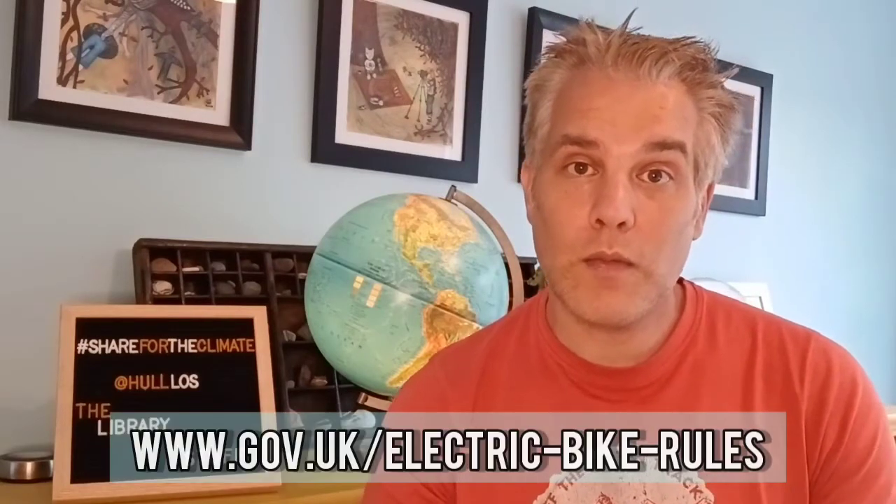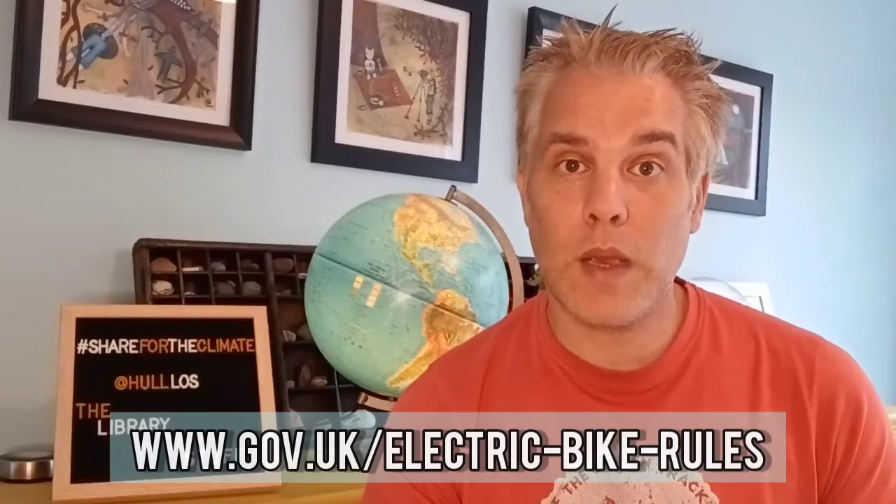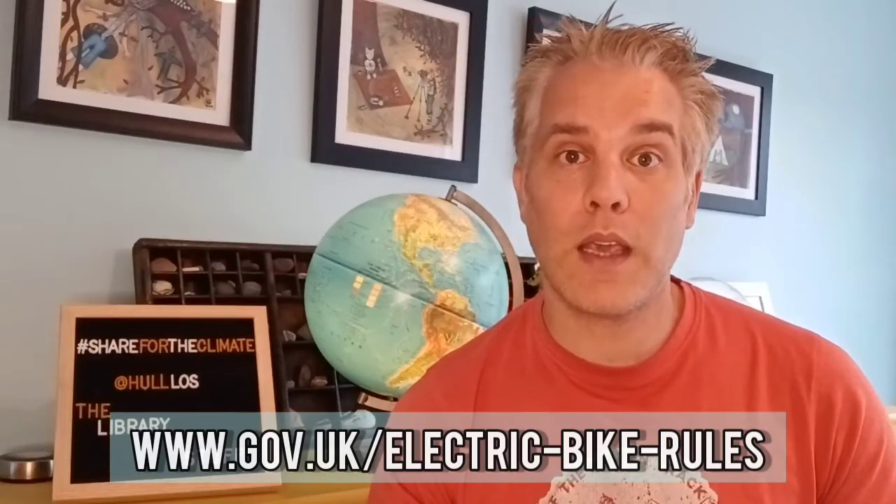Just a quick consideration on buying an electric bike conversion kit. The UK government has very specific rules about what is considered an electrically assisted pedal bicycle, and these rules will allow you to use it on the public road. The motor can't be more than 250 watts, it must display the manufacturer or wattage, and you can't use twist-and-go — it has to be pedal assist only. The maximum speed is 15.5 miles an hour, and the battery has to show the voltage of the battery pack. I would suggest you go on the government website to get the up-to-date information before you buy the kit, to make sure you are buying a kit that can be used on public roads.